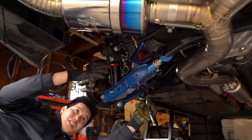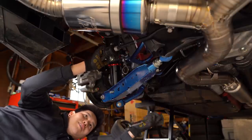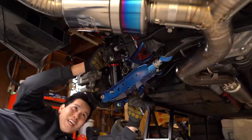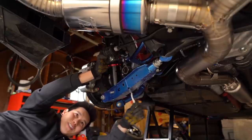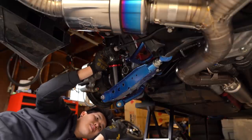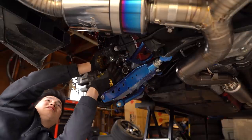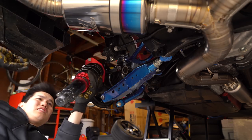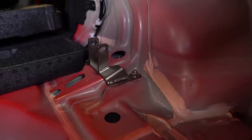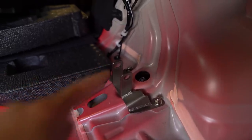This is just another thing about why you shouldn't buy cheap coilovers — it's build quality. This bolt should not be stuck in the lower mount of this coilover. I've run into another build quality issue. When I installed these, the nuts threaded on just fine, weren't cross-threaded, but when I went to remove that one, it has completely seized up. So I'm likely going to have to break the stud off.